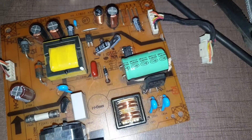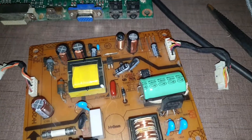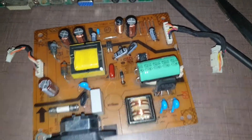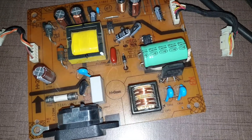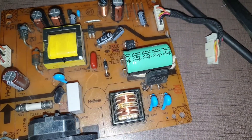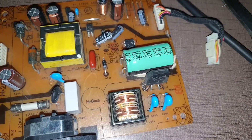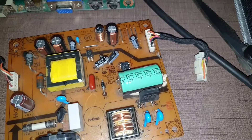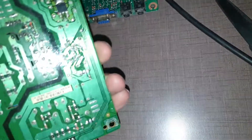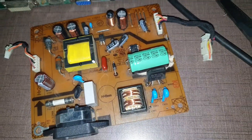Please make sure that if you are opening your monitor, refer to a manual or at least watch a disassembly video first, because there are a few screws hidden in Dell monitors — one is behind the Dell logo on the back. I was trying to pry it apart but couldn't, and found out there was a hidden screw. It really saved me from breaking my power supply card.